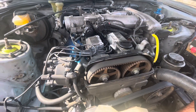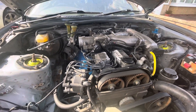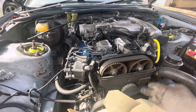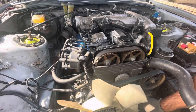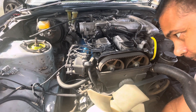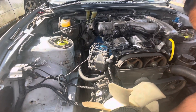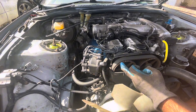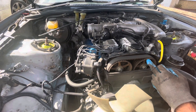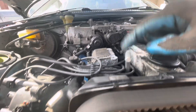As you can see now the piston is going down - the reason we're going to keep turning is because this is not aligned yet. Keep turning until the piston comes up and this lines up as well as the crank mark below. I'm going to line the cam marks up first and then we'll check the crank. As you can see these are lining up now, so when this lines up the piston should be coming up at the same time. There you go - these are lined up and the piston is at its highest position.